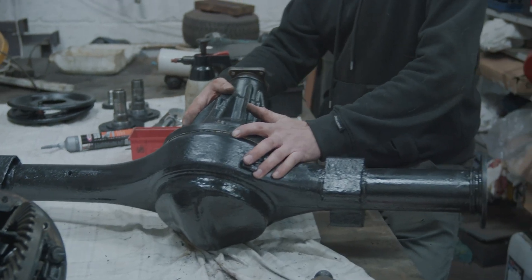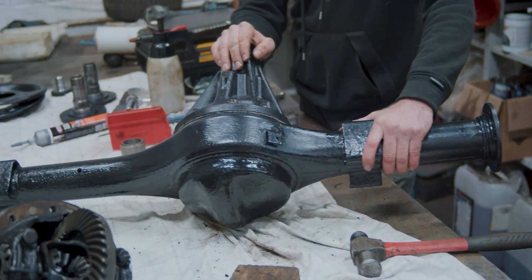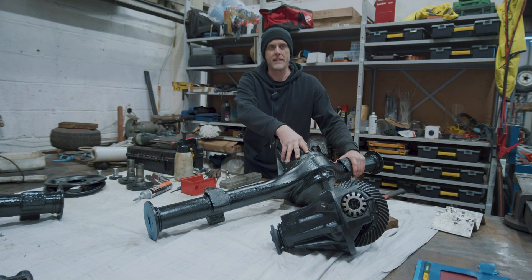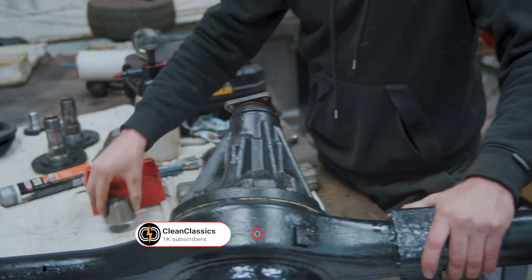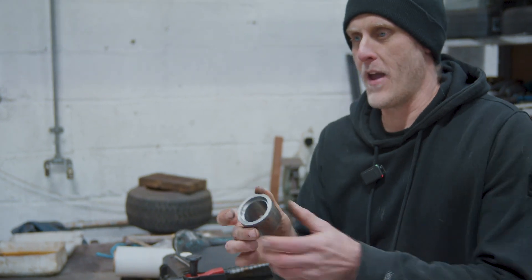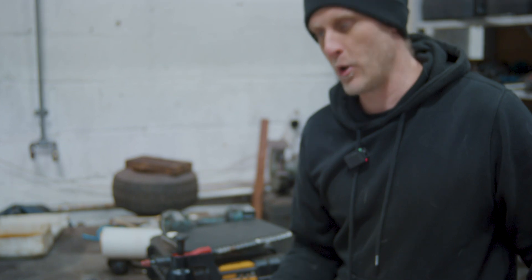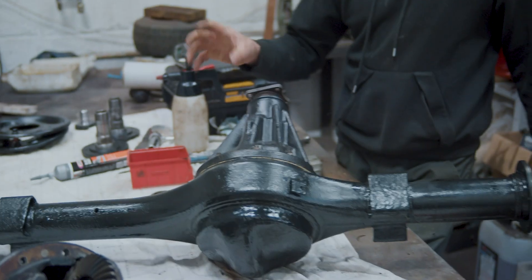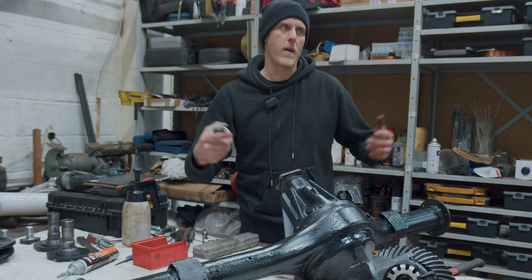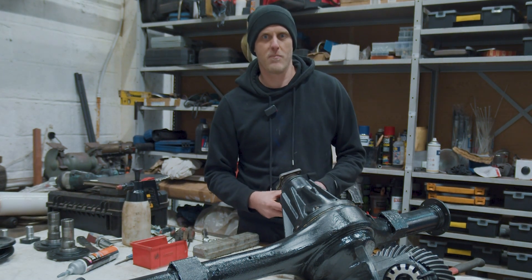This is the rear axle — diff's been cleaned, inspected, and fitted back in with a new gasket. I've also changed the diff pinion seal and inspected all of that. I use a little tool I knocked up on the lathe for that job so you can get the double lip seal in without damaging it — the inner lip sits in the rebate in the tool and you don't need to remove the pinion shaft to put the new seal in nice and square and flat. When ordering seals, I always try to go for one with a G at the end of the part number — that denotes it's genuine or of OEM quality. It's not worth scrimping on pinion seals. You can buy one for a couple of quid but if it only lasts five minutes you're doing the job again, so it's just not worth cutting corners.